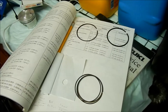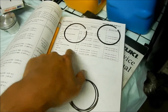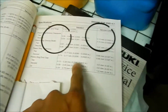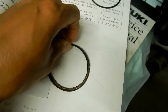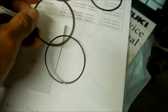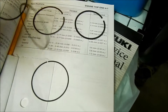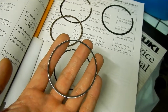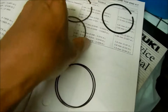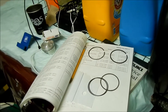So we've got all the ingredients for success. We know which one's the top — number one ring is this one right here, number two is this one, and then the oil rings. The expander — I'm pretty sure you don't measure the expander, just the oil ring rails. And there's no top or bottom for the oil rings — the manual said so. The oil ones feel really, really fragile. Armed with that knowledge, we can set the ring gap — that'll be the next clip.